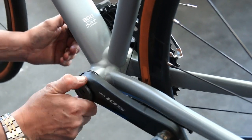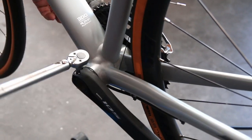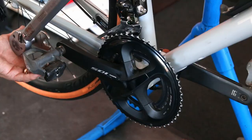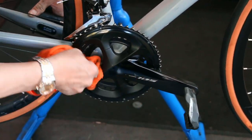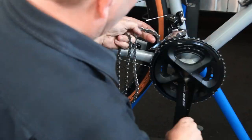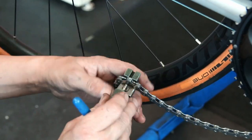A little bit of Shimano grease on the chainset itself before putting the pedal arm on, pre-tensioning the bolts in. This is now spinning beautifully on the new bearing. The non-drive side on the old bearing was almost locked up — that bearing just hadn't survived very well — so we sorted that out.